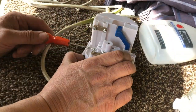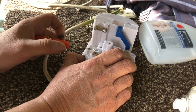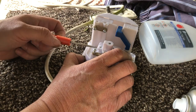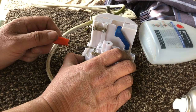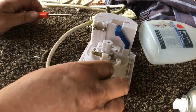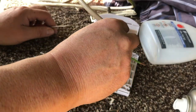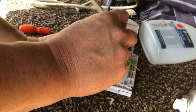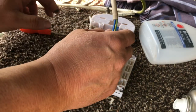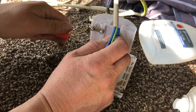So, two screws on each terminal, so quite nice. Well, the screws look a bit eccentric headed. This was about £12, I think, off eBay. So I wasn't expecting great things, but it looks okay. The trick with these double ones is to use the far terminal, far screw, as if it's the only one. Make sure it's mechanically got it, then tighten the other. As you can kid yourself into thinking they're both tight and neither of them are very.